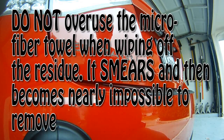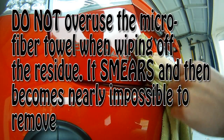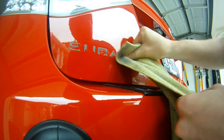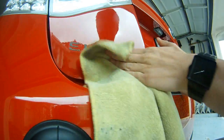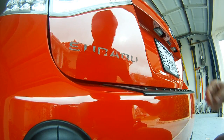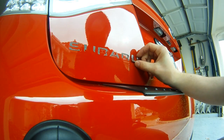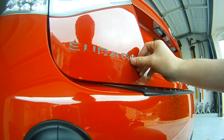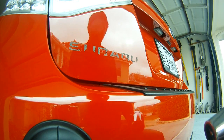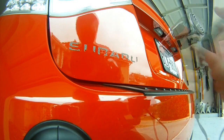I can just sit here and wipe it, but that's probably just going to be tiring and it's really not going to do a whole bunch. What I'm going to do is clean it off real quick and go ahead and reheat all this stuff. These letters were small enough to where I could seriously just peel them off - I wouldn't do that on all emblems. Like this U right here, I just got it and twisted it and it just came off. It just needed heat. So I'm going to go ahead and heat this stuff back up and just kind of peel it off.